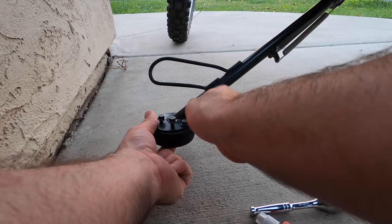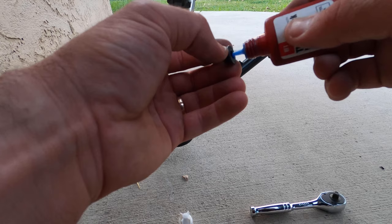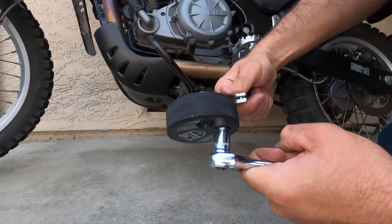When tightening the bolts, be sure to use thread locker. Red is more permanent than blue, regardless of brand. Loctite is the more well-known brand, but any will do. Hand tighten all three bolts first, and then go ahead and crank them down consecutively with the socket and wrench. There aren't really any rules regarding the torque here, so just follow your intuition as to how hard to tighten these. The grade 8 bolts are really quite strong.